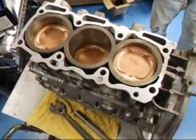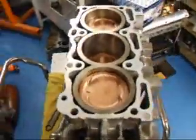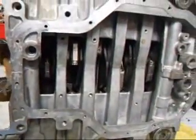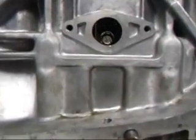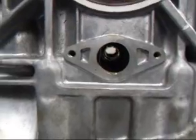The first three I actually put the pistons on the rod and put the crank in the block and torqued everything down to get that all set up. Then on the other side I stick the pistons in the block and now we have the center connecting rod at or near bottom dead center, and what we're going to do is put the pin in here and then put our keeper in. So we're going to show you how that's done.